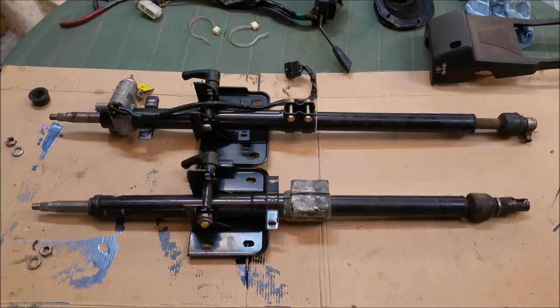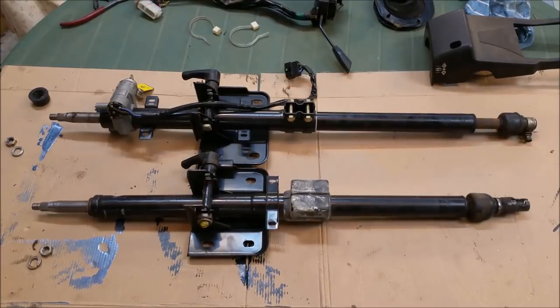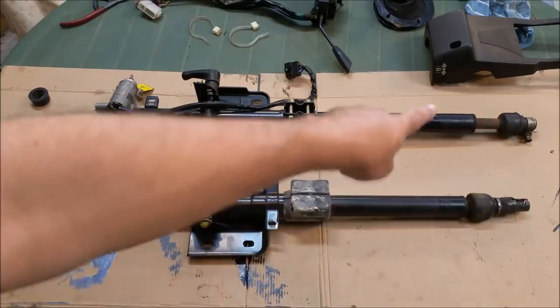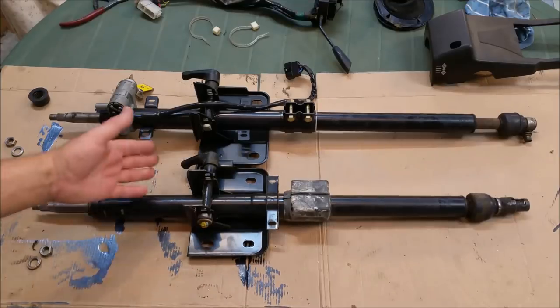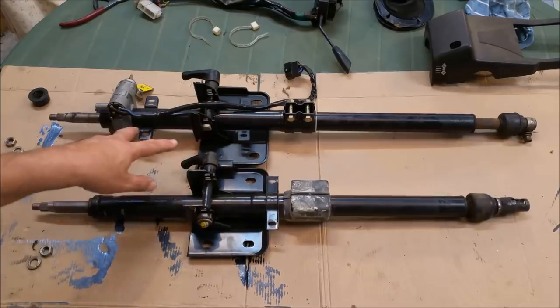Last chapter we touched on these steering columns - we have the GH one here and the GK power steering one here. There are a lot of similarities but quite a few differences: the GK wheel is closer to the dash, it's a tiny bit shorter in this area, and shorter on that end for the steering box. The GH one has different bracketing, and that's the steering column shroud.